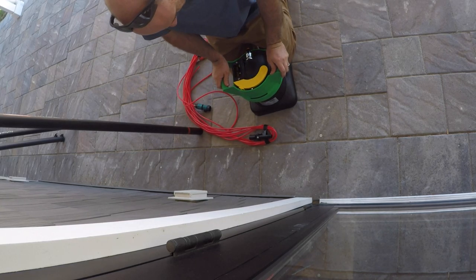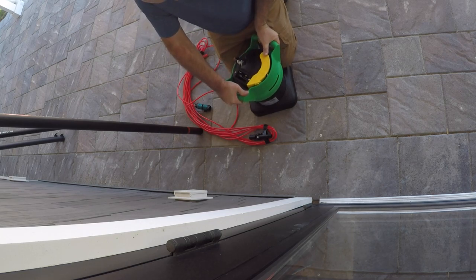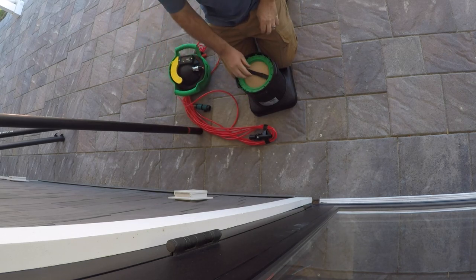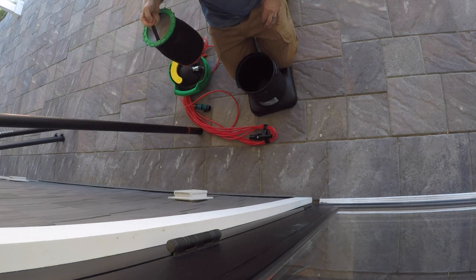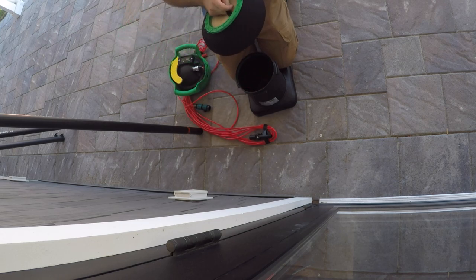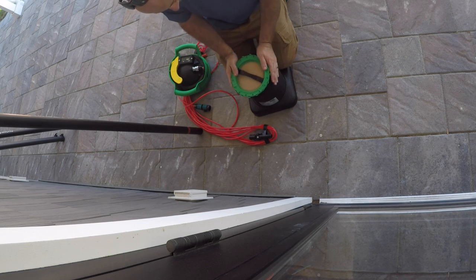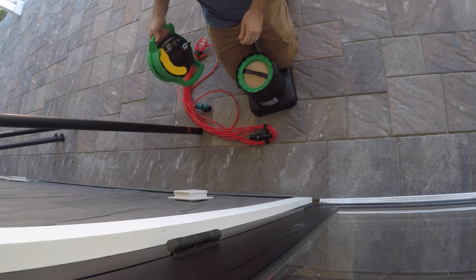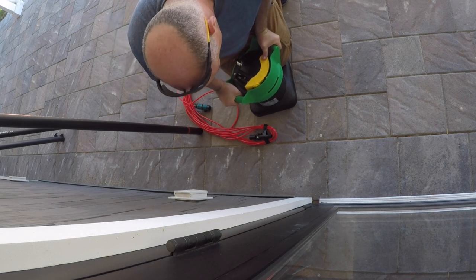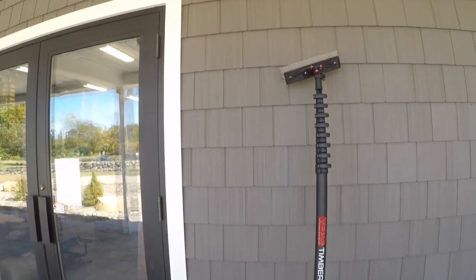Let's open it up and see what the resin looks like inside. You secure the bottom by putting some weight on it, press the yellow lever down, press the lid down slightly, turn and lift — the lid comes off easily. Then you pull out your old bag of resin and install the new one. Put it in, wiggle it down to make sure it's secured and compact, turn and press down, and your resin is changed. It's quick and not messy at all.